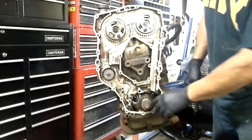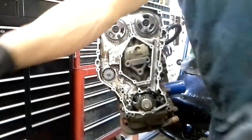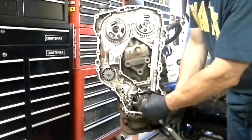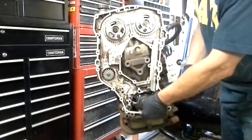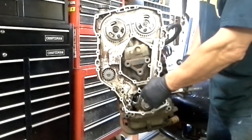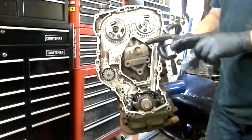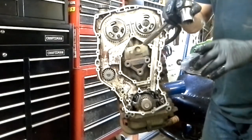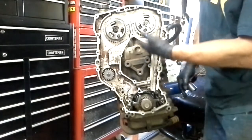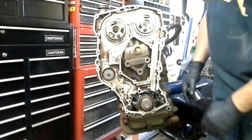Since it's in time and everything, we're going to remove the bolts — this will come off and just kind of sit there. The cams might rotate just a little bit, but not enough to make any difference. But as a little bit of extra insurance, what I'm going to do is rotate the motor backwards about a quarter of a turn, just like that. What that does is bring all the pistons down off top dead center. After I get the cams in time again, I'll slowly bring it up to top dead center and put the timing chain in. The four cylinders are a two up and two down motor — the outside cylinders will be up and the inside will be down and vice versa. By turning this backwards slightly, it gets all the pistons moving down just a little bit, and I can actually spin that cam now and it won't bend the valves. So this is just a little safety measure that I like to do.